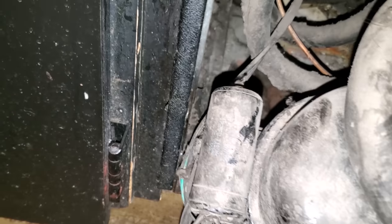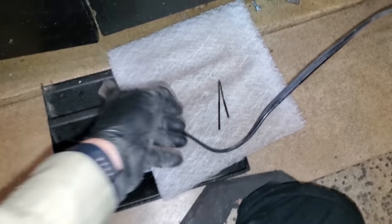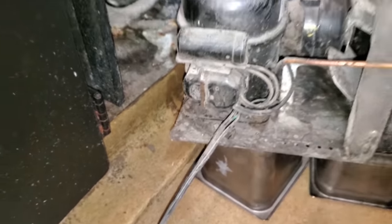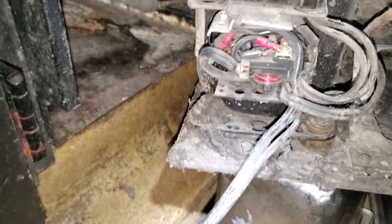The cord that plugs into the compressor goes all the way back there — it's that gray cord. It's so short that I can't get it out. I managed to find the breaker and turn off power, but it's going all the way back there and I think it plugs into a receptacle. I might have to just cut the cord off just to be able to diagnose it. I was able to get it unplugged, but good luck getting it plugged back in. I'm probably going to have to put a longer cord and put some quick connects on it or something.